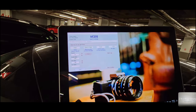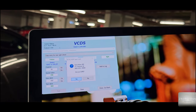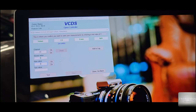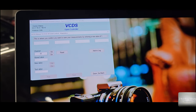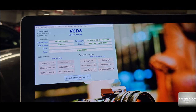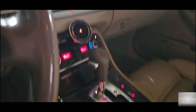Let's add two millimeters, then test and save. Once you've done that, go to channel five and store what you've done — the new value is one, it's a confirmation to store the new values. Save. Done. If you have a fault code, you can now clear it.